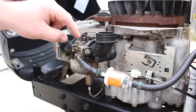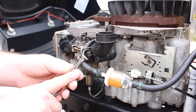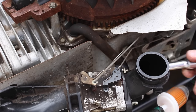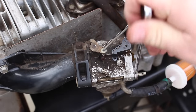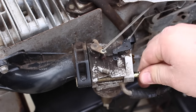In order to remove the black air filter elbow on the front of the carburetor, I used an 11 millimeter wrench for the outside bolt. On the inside bolt, I had to actually remove the crankcase vent hose — this gave me extra room to get to the nut with the socket. Next, I used a 5/16 inch wrench and loosened up the carburetor bolts from the intake and removed them by hand.